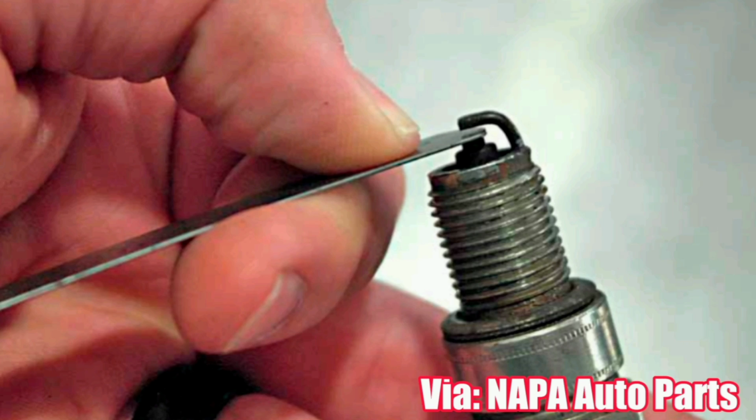However, as you're adding power, that also again increases the heat, increases the pressures in the combustion chamber, and that can prevent the spark from effectively jumping between those two components. So in those cases, you need to reduce the gap so that the spark can still fire. And hopefully you'll notice between these two, they're not really power adders. They're something to compensate for additional power.